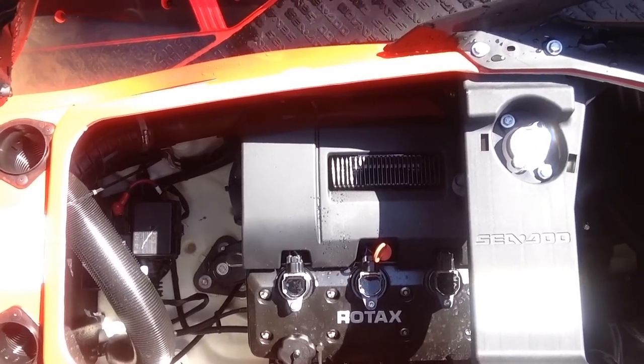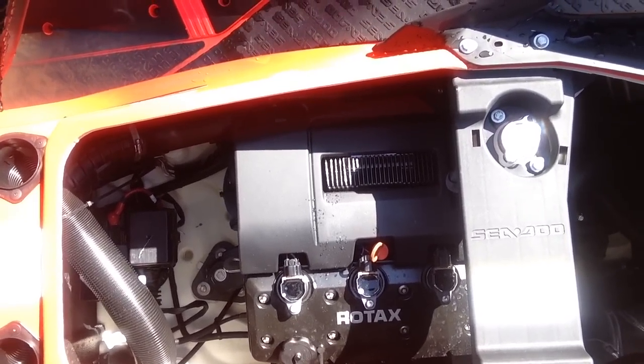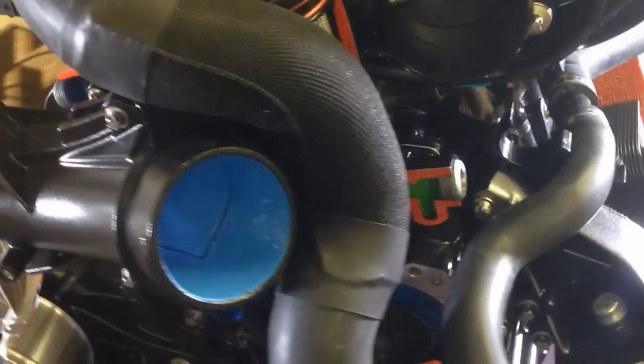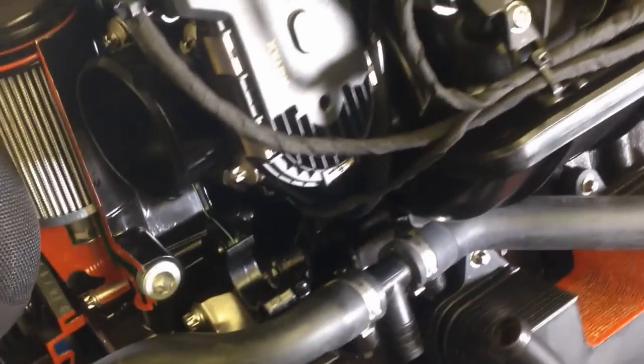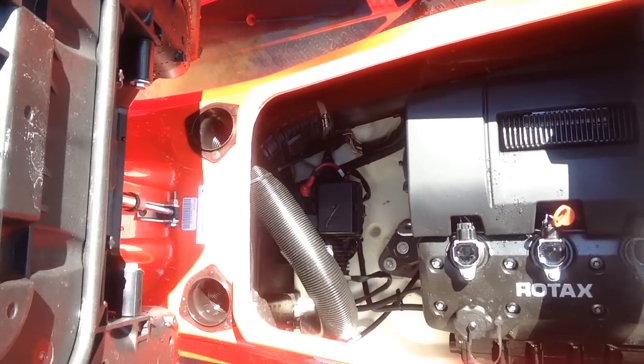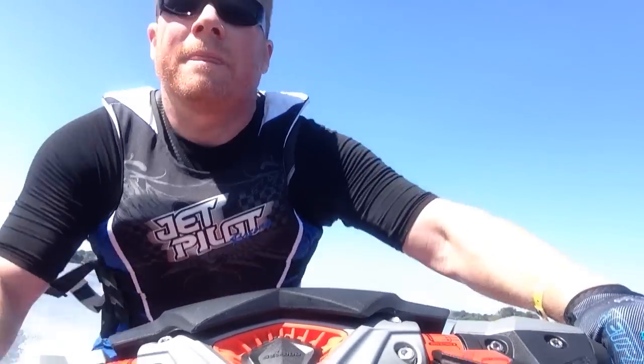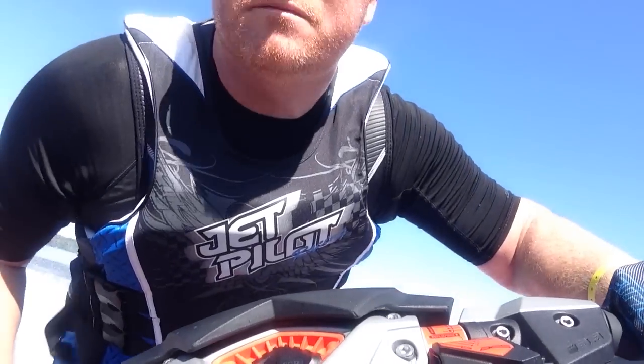There are some major changes that are very noteworthy. They drastically improved the oil cooling and the water jackets, so you're dropping that internal engine temperature. There's an external cooler that is almost double the size of the previous one, and the battery has been moved forward. It's a very smartly redesigned engine compartment putting all the weight center right underneath the rider, with the motor directly underneath you.